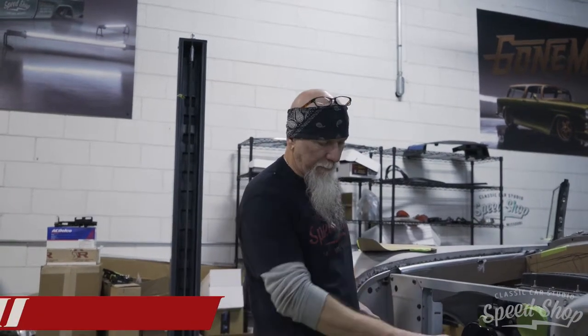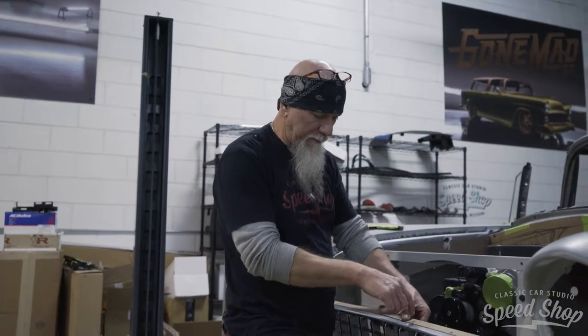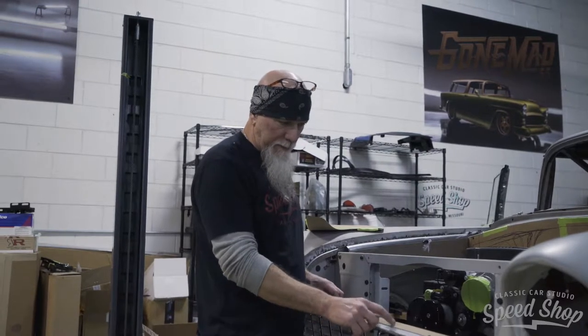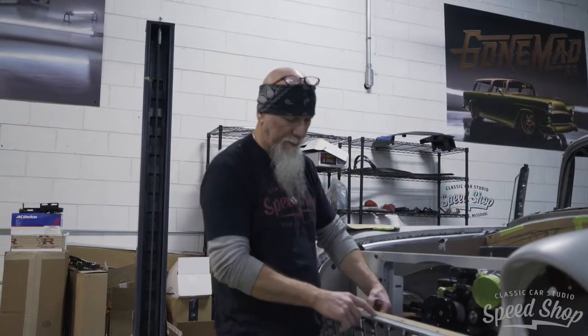I got some panels made up here for the 55, and this is actually covering the top of our grille — it's kind of ugly under here. So I made this sheet metal piece up, but we want to hide the fasteners so we don't have six fasteners going across the front. I made this little template up and I'm going to cut it out of 12 gauge on our plasma cutter. It makes it a lot easier with the plasma cutter because this arch needs to be exact.